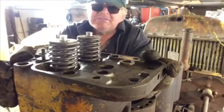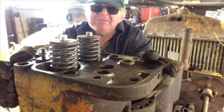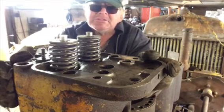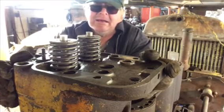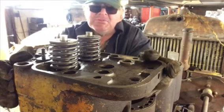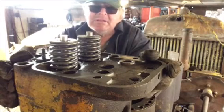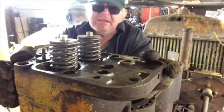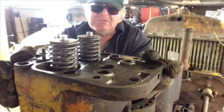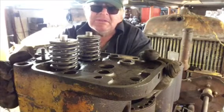and I want to have the exhaust manifold all ready before I lift the heads back off, put the studs in, slide the heads on, angle them so they fit the manifold properly, and then I'll tighten the heads down. So now I've got to continue with setting the other 4 heads on and start working on the pushrod tubes, water manifold, and exhaust manifold.